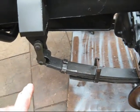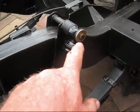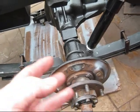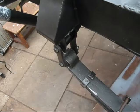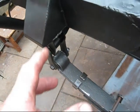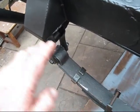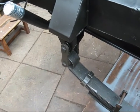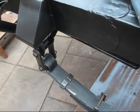That's one side with shackles and pins in — it is a struggle, not easy. If you jack that up, hook it on, tighten it up — it doesn't sit right at the moment because it needs weight on it. Once you put the wheels on and there's weight, it should square itself up. Don't forget your shackles are threaded one side, so push your bolts through, wind them into the shackles tight, then back off a quarter of a turn — perhaps a little bit more. When you put the nut on, hold it so there's that little bit of movement. The shackle should be free to move backwards and forwards; there's no good locking those up rock tight. Put a bit of grease on the bolts.